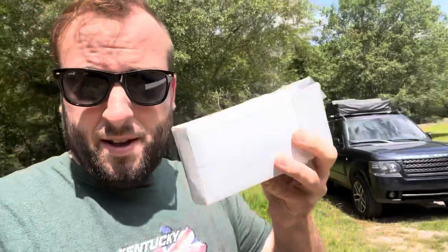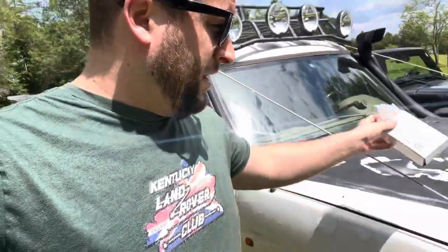Good morning world, today's discovery day — we got parts. This thing's been parked for about a week. Drove it to work, drove it home running fine, got to a stoplight and the clutch just started getting weird, started dropping to the floor. Compressed it a couple times, it'd come back. Dropped it to the floor, got it home, noticed the fluid for the master cylinder was low, and I decided to top it off — blew it out real quick, stayed in there no problem.